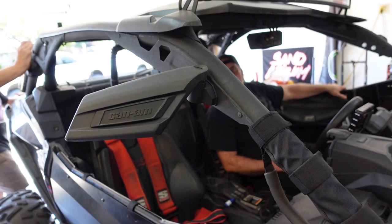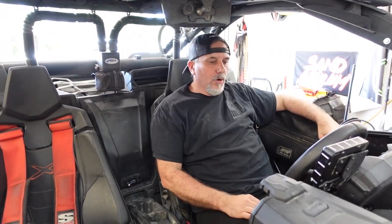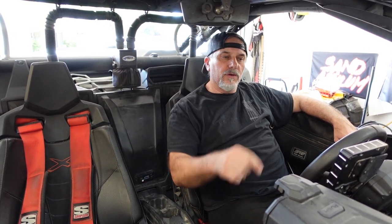All right, so what we did, like I was saying, we got the spring in for 2300 RPM. We let it warm up a little bit. We put some air on the tire. We put the rear stabilizer bar back on because we were about to pull out without it. Ran it up, it looks like it hits about 7 pounds of boost. We're gonna go see what it does. I'm not gonna run a 0-60. That's a video coming up.